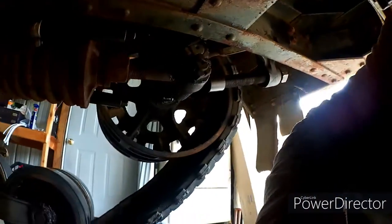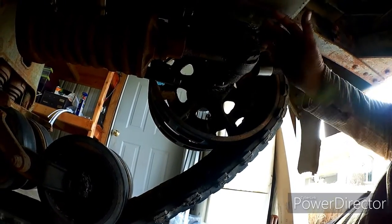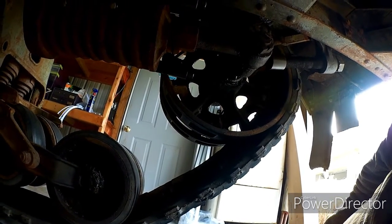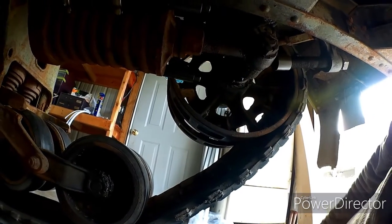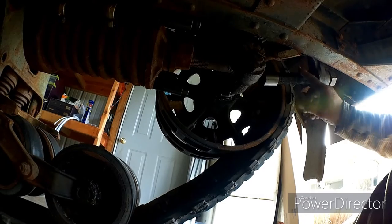That had the old style adjuster, so that's quite an advantage, because you didn't have this big spring. All you had was a link with two nuts, and the whole link dropped out, and then the adjusting sprocket went forward. Unfortunately, we have the spring here, but your adjusting screw here works very well.